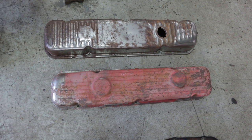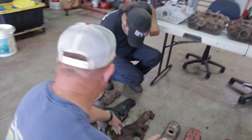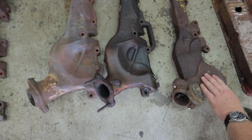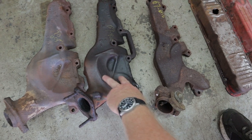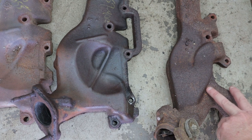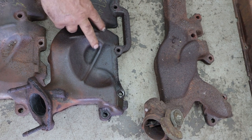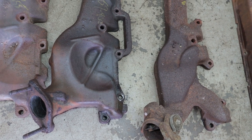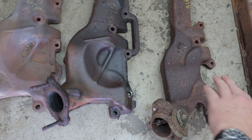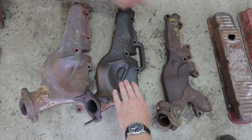So exhaust manifolds — I've got three different types here. These are three different driver's side exhaust manifolds. This is a '67-'68 big port — it actually flows the most. If you look at the design, this one has a much more open center port, so it flows a lot better. This is a very desirable exhaust manifold if you want to build a stocker. You can see they merged runners here and gave it its own runner — it's actually a nice piece. This one came out of a '67 Riviera, directly off those big port heads. That's why I think the big port heads had considerably more power.